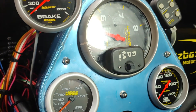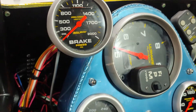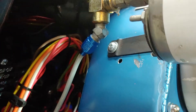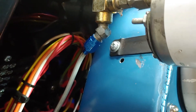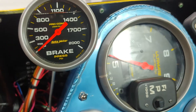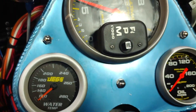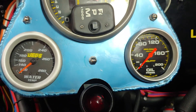At that point, don't forget you'll have to bleed the brakes, because we took off that line for the brake so we definitely got air in the line. Before you drive or after you've got this thing installed, you want to bleed the brake system to be sure there is no air in it at all.